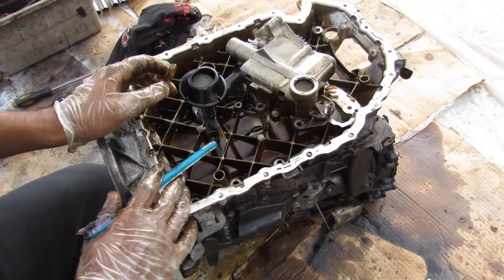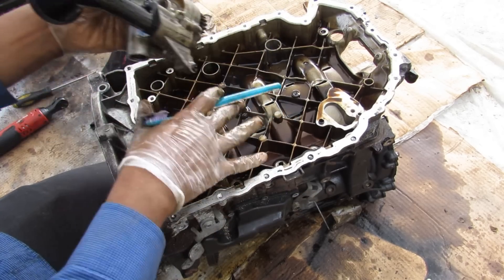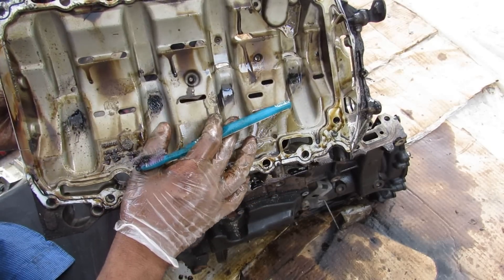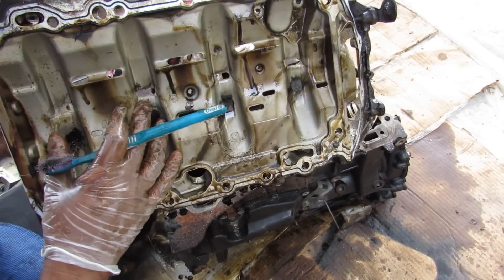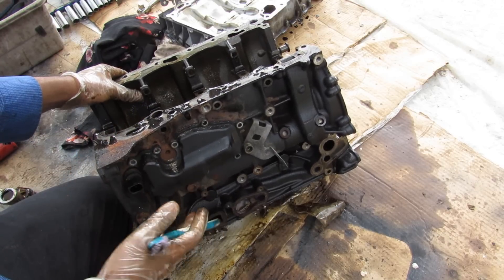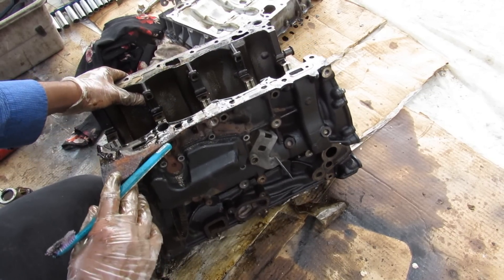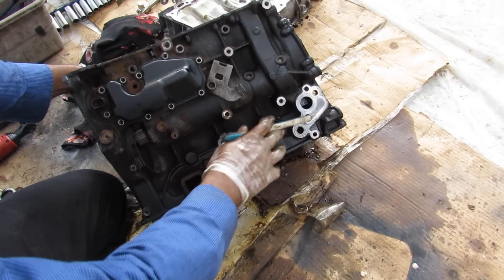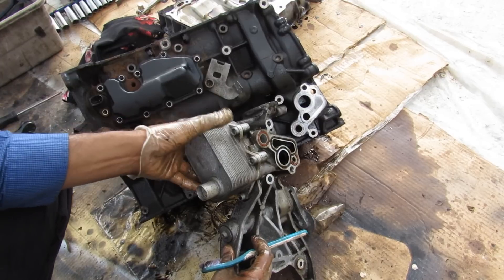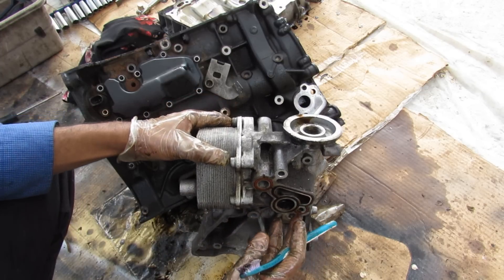Now that the engine is completely torn down, let's take a closer look at the components. Starting at the bottom with the aluminum upper oil pan: the oil pump draws oil from the pan area down into a port, and following that port it leads up to a hole in the block. The upper oil pan functions more as a baffle or splash guard for moving oil rather than supporting the bottom end like bearing caps. Moving to the engine block — which is surprisingly still made of cast iron — the oil from the oil pump flows through a hole at the front of the engine down to the oil cooler and filter assembly. That assembly houses a heat exchanger that circulates coolant from the water pump around the oil to exchange heat.